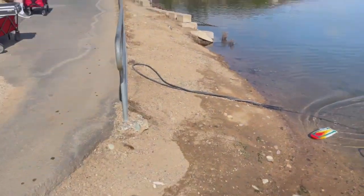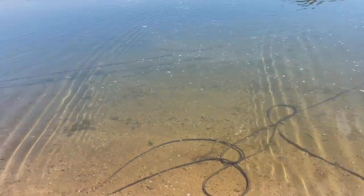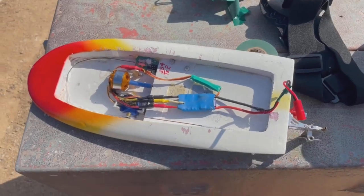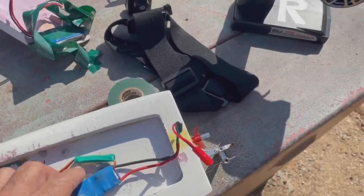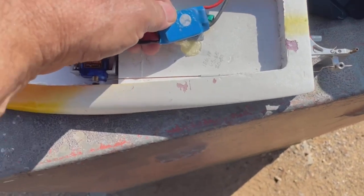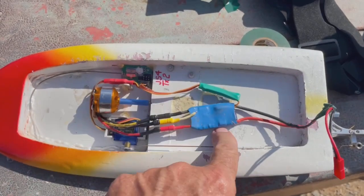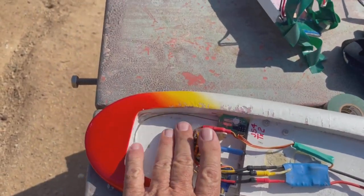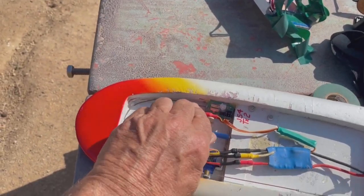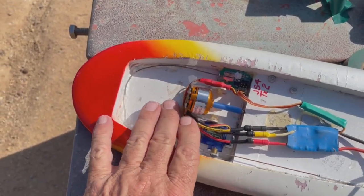I think that's the battery. Okay boys and girls, here's the post-mortem on the jet stepper. The magic smoke has been emitted from the 18-amp speed control. The motor is barely above room temperature — right now it's actually ice cold. So there may have been water on here.